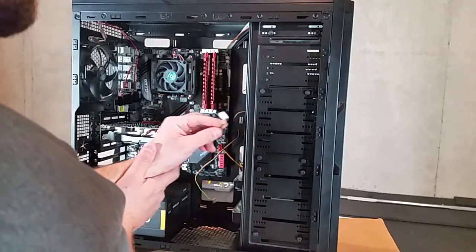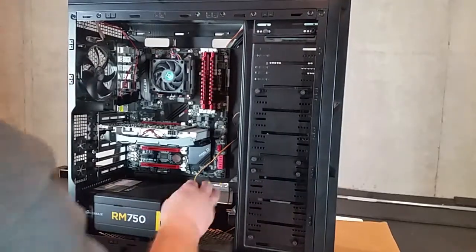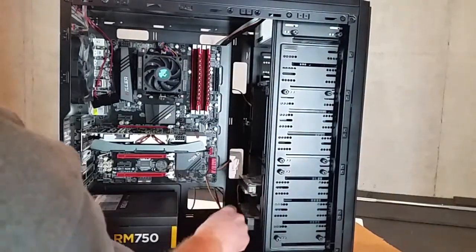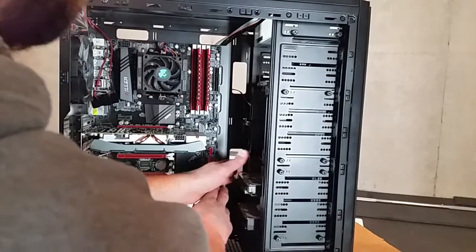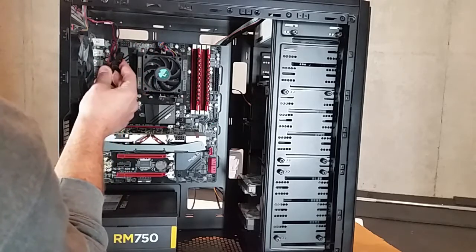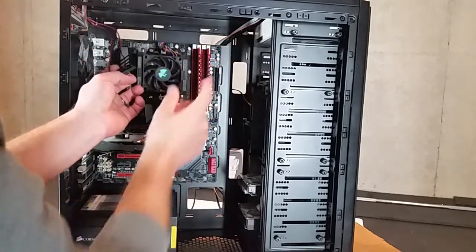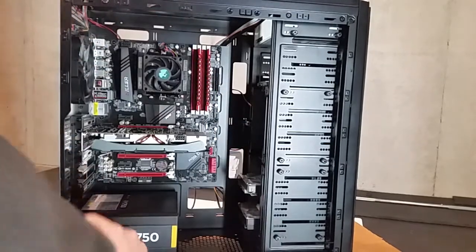This here is a fan. I have two front fans, another fan up top, and one more here — those are all case fans. This one I'm going to send out the back. These two fans come with what I think is called a four-pin Molex connector. You can connect them both together so all they need is power on one side and it will power both. You can chain these all together — I wouldn't chain more than four of them.